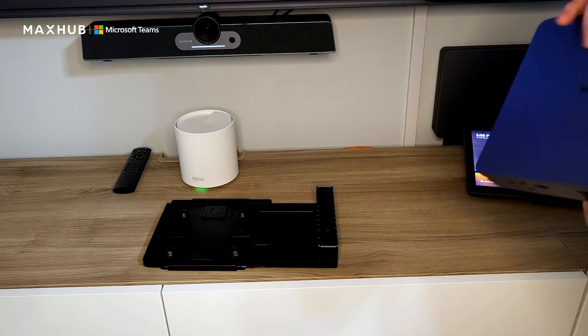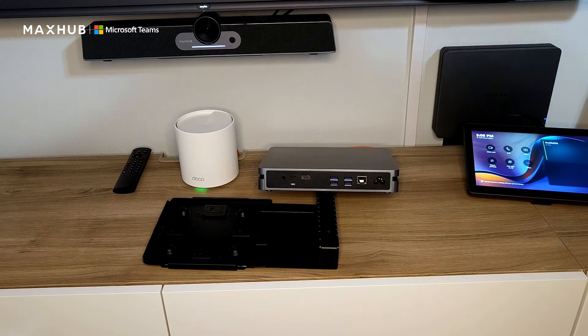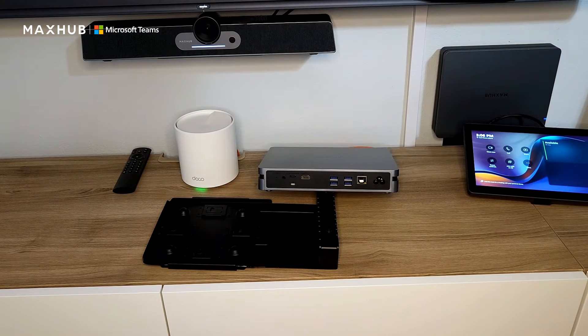Now, I'm going to flip it over and show you a little bit more about the ports on this. Your XC13T is a single HDMI output device. It's going to connect to your network via Gigabit Ethernet. We've also built the power supply into the chassis to make installing the device easier and cleaner. As you can see, it has four USB 3 ports on the back for all of your additional audio and video requirements. It also features a Kensington lock slot and an analog mini plug output jack.